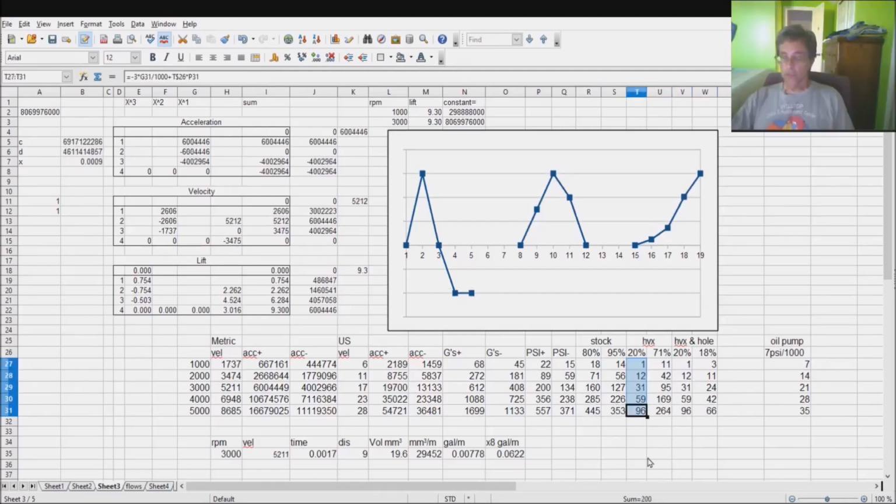Alright, let's take a look real fast at this particular column. This happens to be a Hoover modded motor, so it's got the sliced open lifters. This column represents, again, this particular portion of the acceleration profile. These oil pressures indicate not oil going out to the head, but rather oil coming back from the head. These are backwards pressures. I mean, the push rod goes left, right, left, right. One of those pressure settings is going to cause oil to go, of course, backwards through the system.